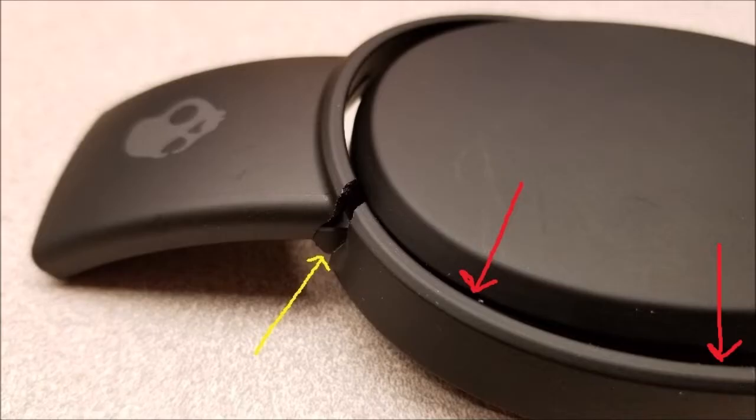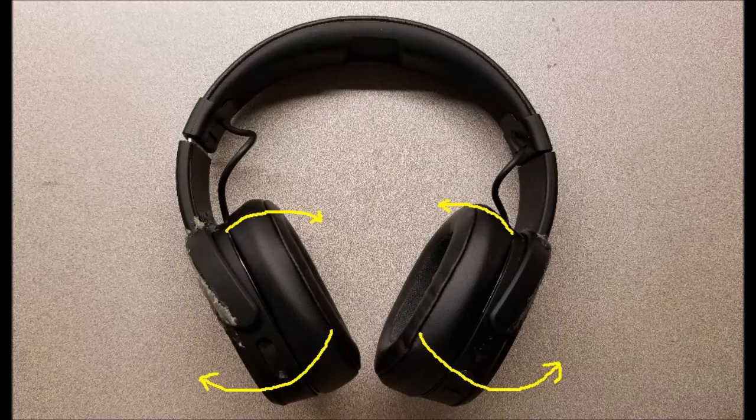Using a small flathead screwdriver, apply lots of the epoxy into the groove between the ear cup and the cradle, and use the edge of the screwdriver to push the epoxy as deep as you can get it, all the way around the top half of the ear cup between the two points where the ear cups attach to the cradle. This is a radical approach. Before you start, make sure the ear cups are at the proper angle to fit on your head. It should be obvious that if you bond those grooves, that is the position where the ear cups will stay forever. They will never move again, but the bond will be bulletproof and your headphones will remain fully functional and usable.